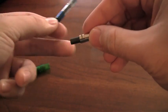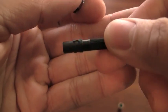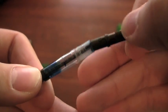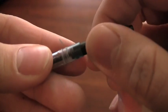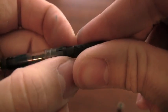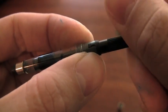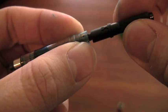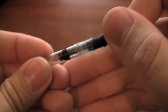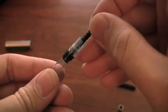This part comes off. There are actually two pieces here — the metal ring holds on this inner part, which has a little latch on it that fits into a little notch, and that's what holds it in place as it screws from side to side. So as you screw it, that's what causes the piston to move up and down. You can actually just pull the whole thing off — it's got a threaded rod here that connects to the back of the piston seal. If you unscrew that all the way, you can just pull the whole thing straight out.